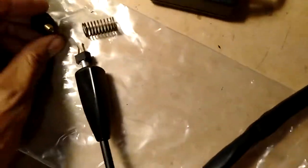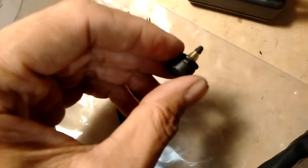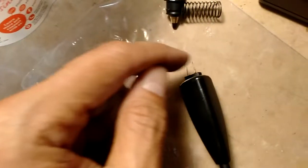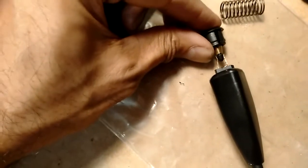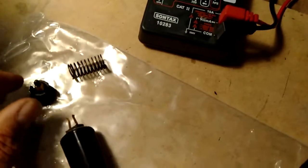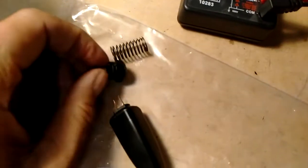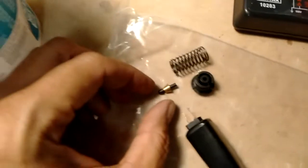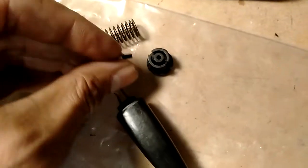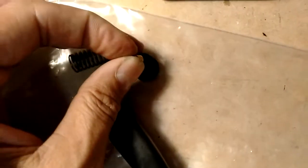But what the actual issue is, so that piece of brass at the end there, when you press the horn button in, obviously that moves down, and then those two metal contacts allow the horn to touch like that, and you can see there the reading. And what actually was happening was this little piece here, I'll just take that off just so you can see how that's loose. That just comes straight off. So that should in fact be possibly glued into that piece just so it won't move.